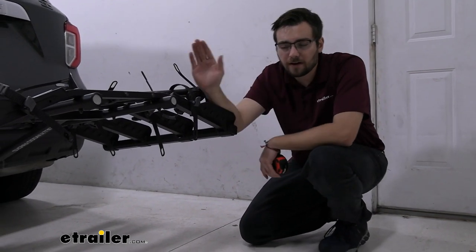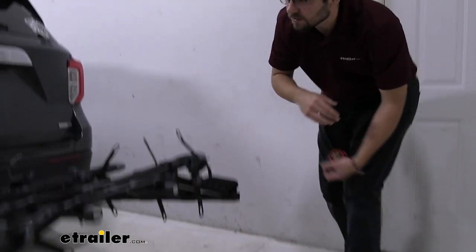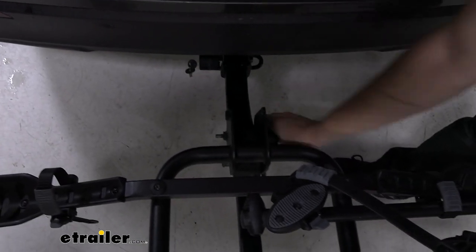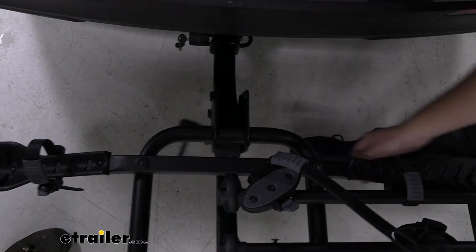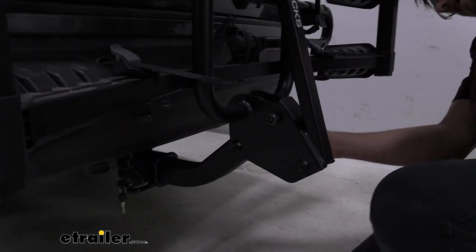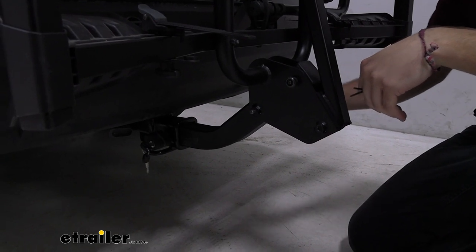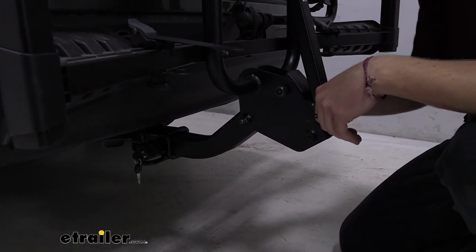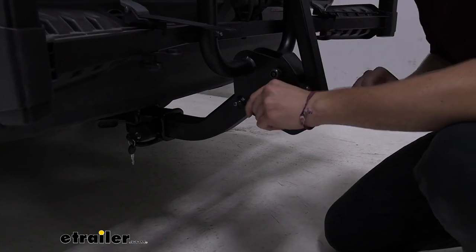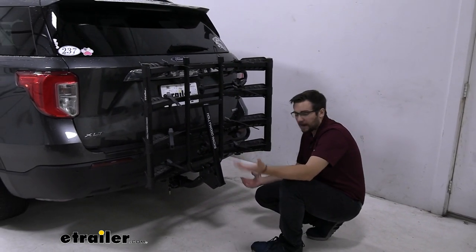Now keep in mind, as those front wheels go up, the back will go down and so will your hitch-mounted accessories. So if you do have any very steep terrain that you're approaching, just watch it and make sure you're not going to have any issues — but I think we're going to be A-OK with 20 and three quarters of an inch. We can quickly flip this up, and to do that I'm just going to bring myself to the middle here. That's going to allow me to take out this clip that's holding us in and then start walking this knob back. I just bring that guy out, then you walk this up — not all the way, but right to about there — reinsert your pin. Then start threading that back in to secure this. The knob is large and easy to grab onto, letting me really start tightening this down so we don't have any shake and play. That's going to shave us down a lot of space, putting you at 14 and a half inches from the back of the bumper to the very end.